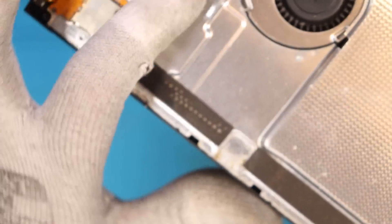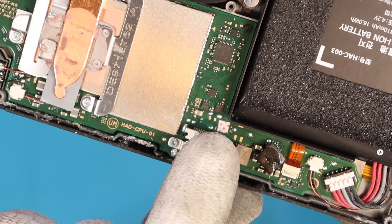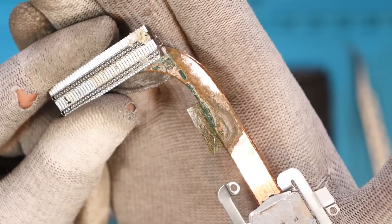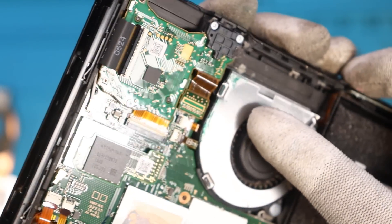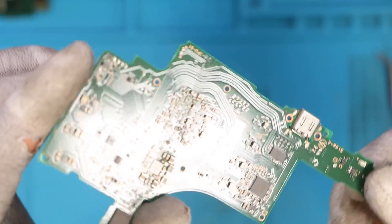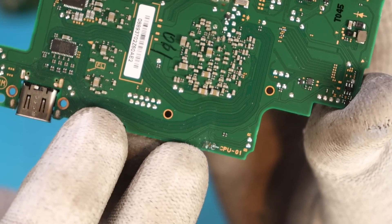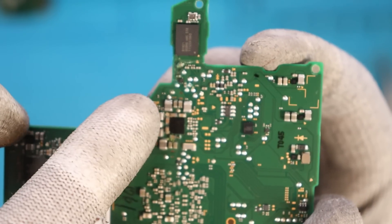There's a little bit of water down here on the metal chassis — maybe both of these last two switches are going to be water damaged. On opening, the water damage indicator is still polka dot, which means it's okay. However, there is some water damage down here along this whole edge of the Nintendo Switch. For that reason, I don't want to give this power — I'm going to get the board out of the chassis. What on earth — there's corrosion on the fan as well. Maybe liquid went through the top grill and onto here. But there's nothing on the board from what I can see — actually wait, there's quite a bit down here, which makes sense because this is where the fan was.